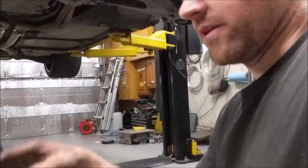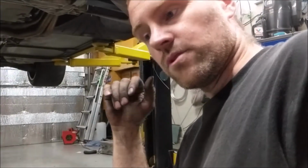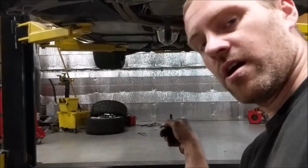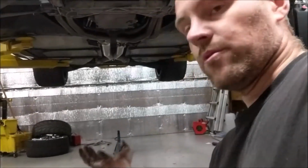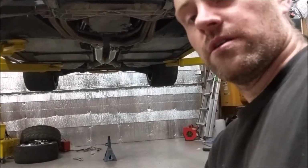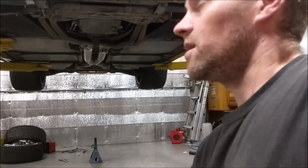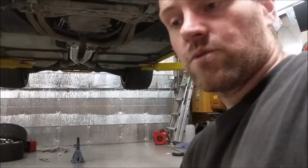The reason for that is because if I were to just put the little jack stands on here, the little ones would actually make the front come off of the hoist, and the back would just teeter because of the position of the hoist. So if I put one in the back of the car, it'll counteract it. It's going to take me a little bit of time to finagle it, but once it's done, I'm able to collapse the suspension enough that I can put those shocks on in a much easier way than if I weren't to do that. In fact, I might not even be able to get it if I don't collapse the suspension at all. Sometimes they'll sit too low and the shocks are what actually holds it in the up position. So that's what I'm going to do next.